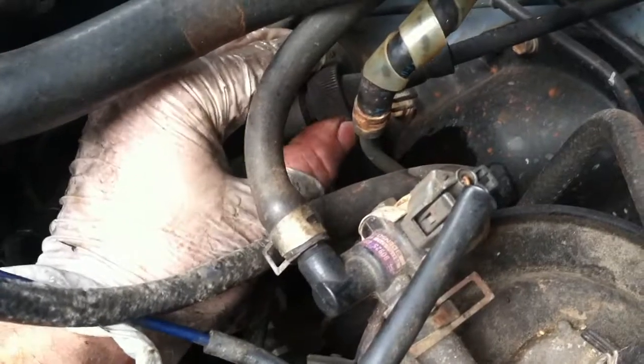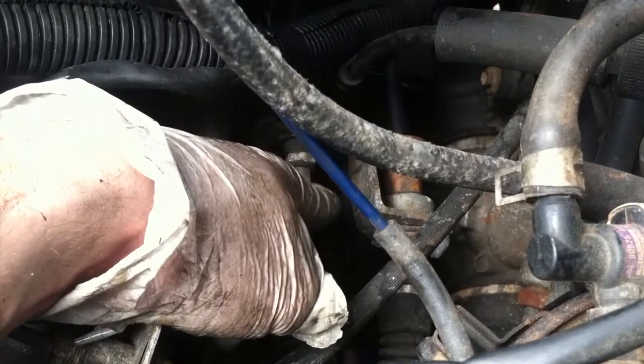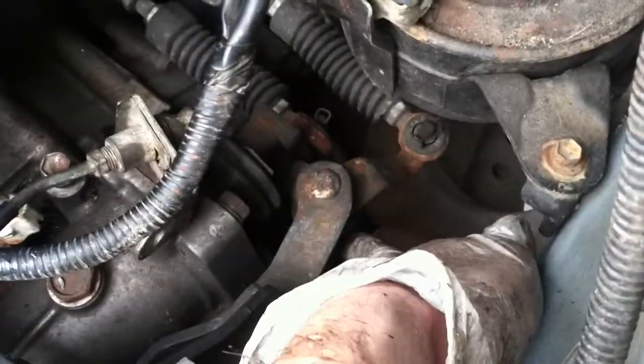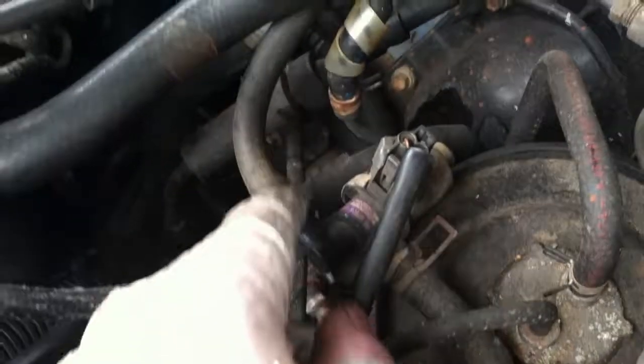Right here, if you look, there's some screw kind of thing, like a bottle cap kind of thing. This is our speedometer connector, and right down here we have 2 more connectors. These are for the clutch. For these ones, I'm probably going to pull the pins out right here and disconnect. There are some weird clips, one on this side and one on the right there. 2 clips. Pull the clips out, and then I'm going to pull the pins out. I'm going to unscrew this to get the speedometer loose, and then we'll keep going.